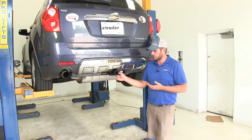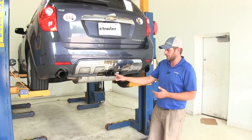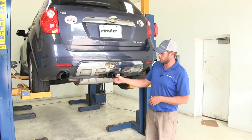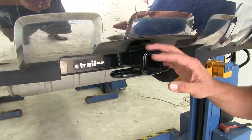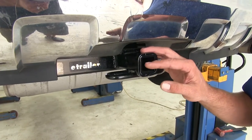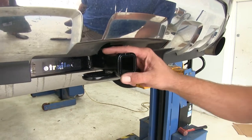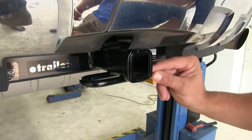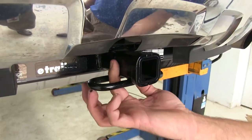This is what our hitch is going to look like installed. You're basically going to be removing this cover — it's not going to go back on after the hitch is in place — and that's going to leave your receiver tube opening, safety chain connection points, and the small cross tube you see here. This is a Class 2 hitch with the inch and a quarter by inch and a quarter receiver tube opening, reinforced with a collar that goes around the end more like a strap that's been welded on. Safety chain connection points are round steel stock material, nice and open so whatever size chain you have should get connected.